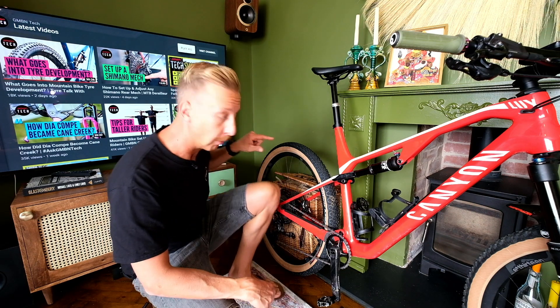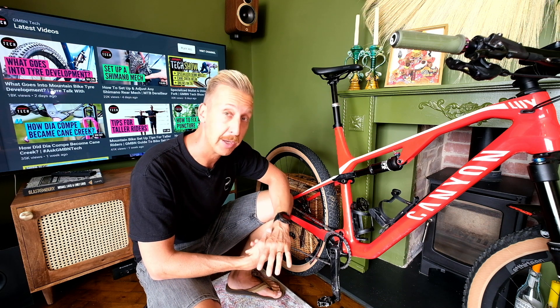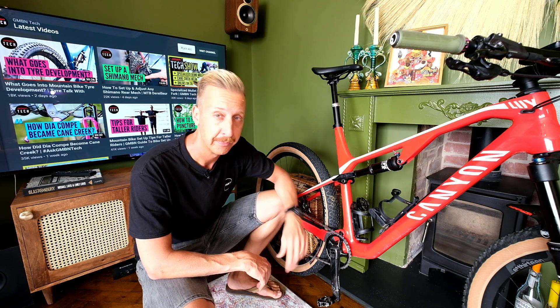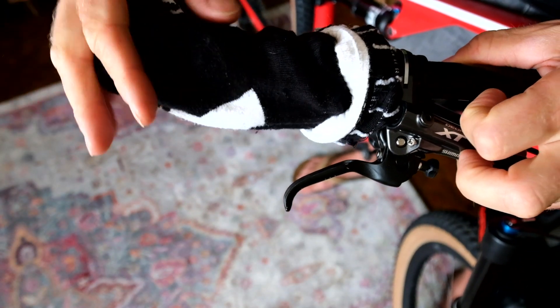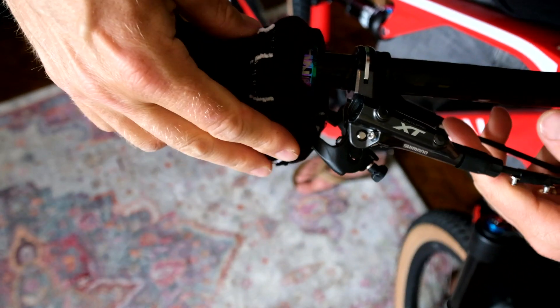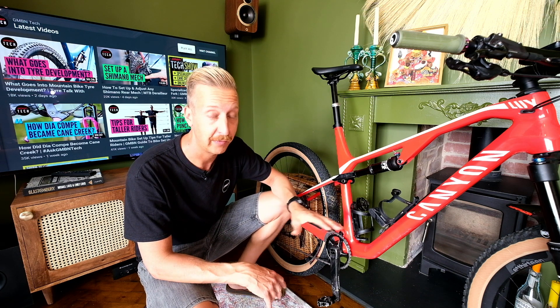What I've found is lean up the back end of the bike. The rear dropout on your disc rotor side is much better to lean against stuff than your derailleur side, because of the fact you've got drivetrain there, so there's more chance of mess getting on stuff. Use that to store your bike up against things. I've also got a cool little hack to basically turn your back brake lever into a hand brake — it just gives an extra element of security so your bike's not going to slide around. You can either use a toe clip strap to secure the brake lever to the bar, or an even better one is to use an old sock. It's got to be quite a tight sock for it to work — you put the sock over the end of your handlebar and straight over the brake lever as well. You might need to roll the sock up a bit just to give enough tension on the brake lever.